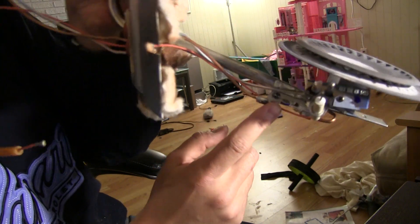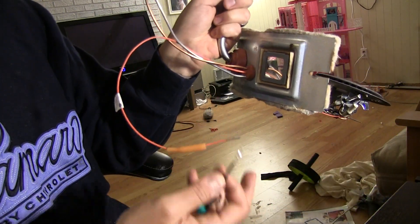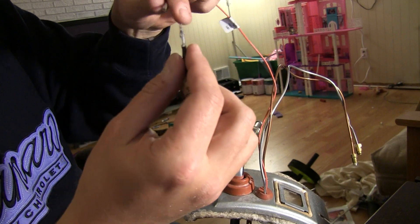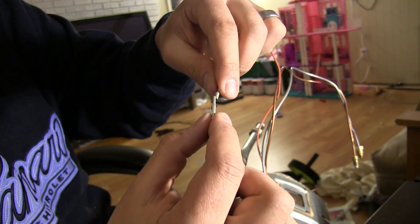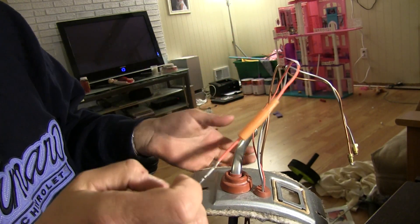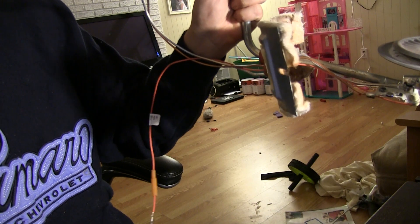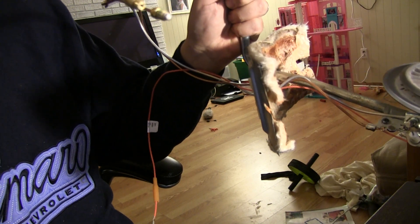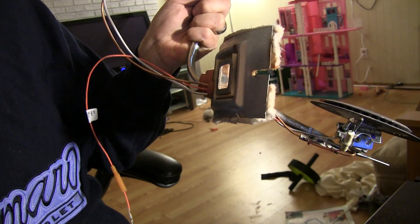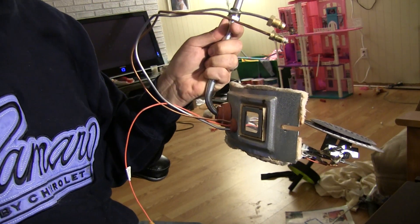Fusible link is still intact, which is important. I'm going to put the igniter back on — that's just the orange cable — and this guy just plugs right in there. With the assembly out, we can test it by hitting the trigger. And there's a spark. So we're going to button this up and see what happens now.